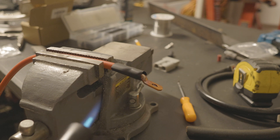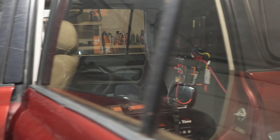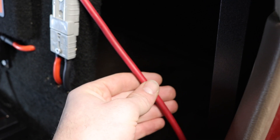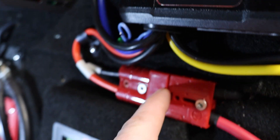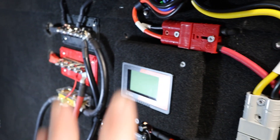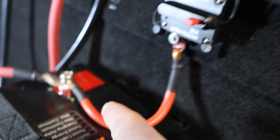I also like large crimpers but this is just what I had. I use heat shrink sleeve on top of all of these and it creates a nice professional clean look. After many hours of crimping, drilling holes, and running wires, we are pretty much ready to go. Let's trace the power: this is the six gauge wire coming from the battery with the 60 amp breaker, going into an Anderson plug which goes into the battery charger — switched over to lithium. It's not on because the car is not on. There's a blue wire for a smart alternator but ours is dumb. The output wire goes into another Anderson plug and then into a 50 amp breaker which goes to the battery to charge it.